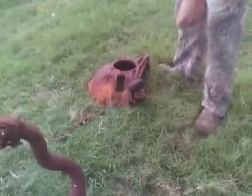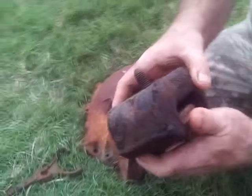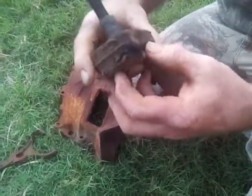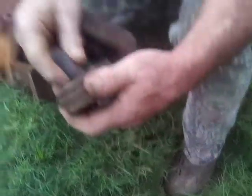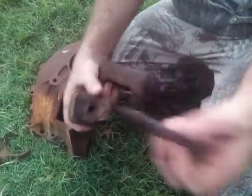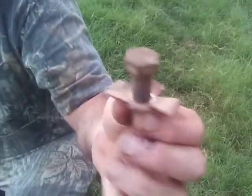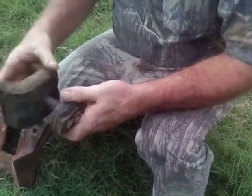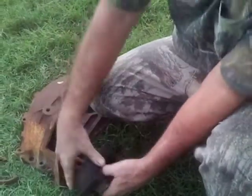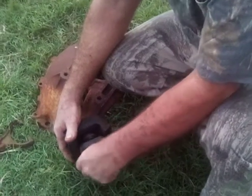And that V8 bell housing bolts down to the cross member. With this kind of system, there's a little piece of pipe in the center of that bottom one. I can get it out. That little piece of pipe. When you put one together, you want to be sure to have the right bolt, a good hard bolt with a lock on it. It goes through that factory bolt and is kind of pointed on the end so you can get started. This goes on the cross member, goes through it, and then each side of your bell housing. Kind of like playing with Tinker Toys.